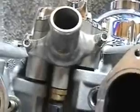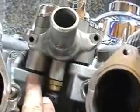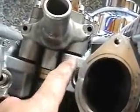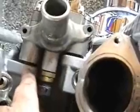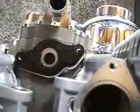The next thing I'm going to do is pull the thermostat housing off. To do that, remove the two screws from the top of the housing. If you look right in here, you'll see two open slots — there's a slot here and a slot here. There's a piece of plastic that goes between the cylinder head and the thermostat housing, same thing on this side. And there are O-rings on the inside of each port. So when you pull the thermostat housing out, those O-rings are what keeps it sealed. Be careful of the gasket.